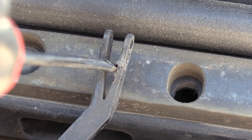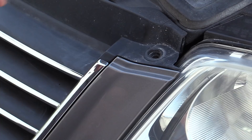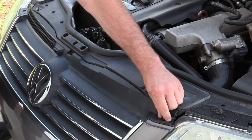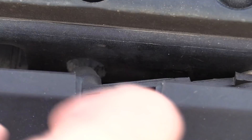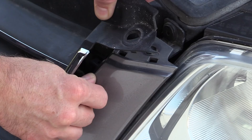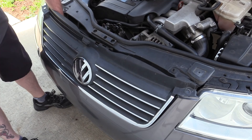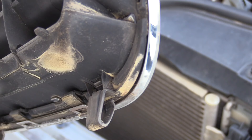Once the tabs are spread open wide enough, pull forward on the plastic hood release pull and remove it from the hood latch. Set these to the side — there are going to be different fasteners, so you may want to group them accordingly. Next, gently pull up and push the tab in on the grill. If it doesn't come up right away, just work your way around it because if you pull hard on it, you might break it. If your grill gets stuck in the bumper, don't just rip it off — reach up underneath and squeeze the tabs. That works really well.